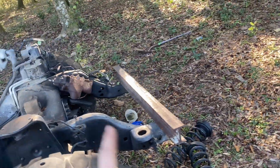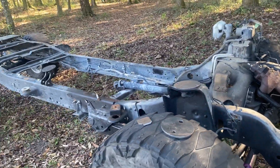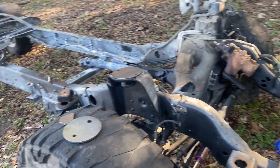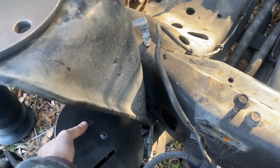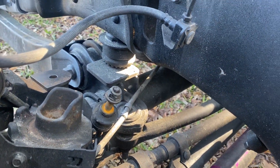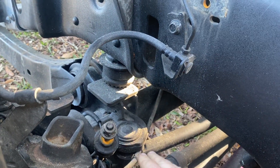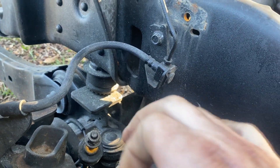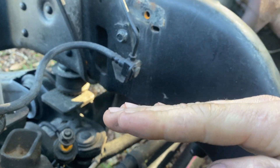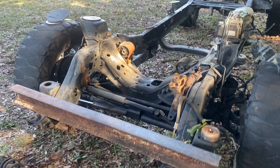The height is set up to be perfect with the back from the quick measurements I've taken from the ground to the bottom of the frame. This has been a bunch of work sitting on the couch designing and drawing everything after dinner. For the track bar, I dropped it all the way down — you want a track bar as flat as possible because if it starts out super angled, as it goes through travel it'll push the axle side to side a lot more. I bought a book on designing air suspensions and have read over it a couple times.